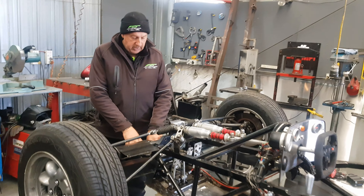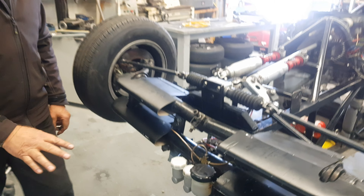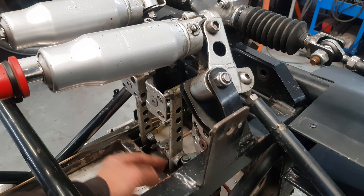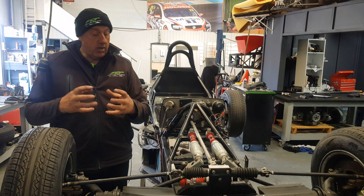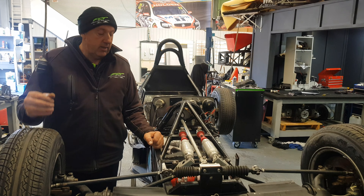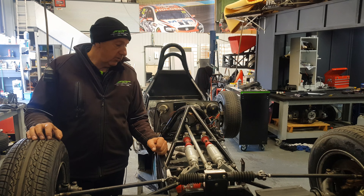Coming to the front, obviously we've got our clutch and brake fluids — make sure they're topped up and bled, they shouldn't be discoloured, they should be nice and clean. Coming to the brake, clutch pedal, and accelerator — make sure these are all nice too, not too much movement sideways. Most cars have a bolt situation down here that you can tighten to stop sideways movement. Make sure your brake bias is adjustable, it's moving, it's free — normally you might have to take your whole brake bias out every year or so, clean it up, put it back. A lot of young kids don't even know what a brake bias does — it's very crucial to get the balance of your car right by adjusting your brake bias a little bit forward or back. When you're getting to be a better driver you'll start realising how important that is, so you must have a brake bias that works nicely. One or two clicks either way can make a big difference to your handling of the car.